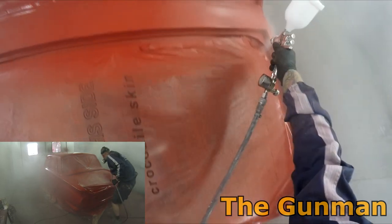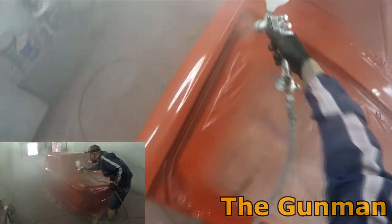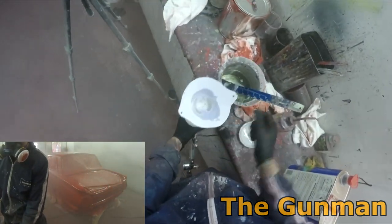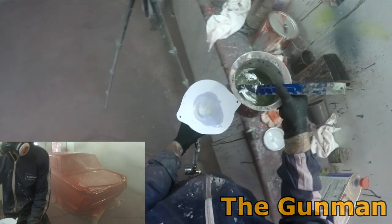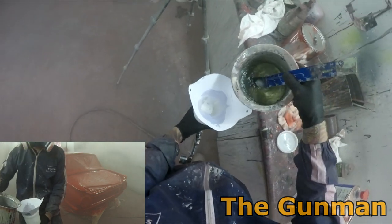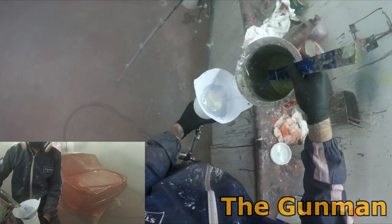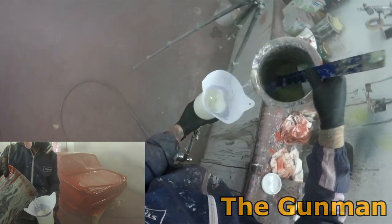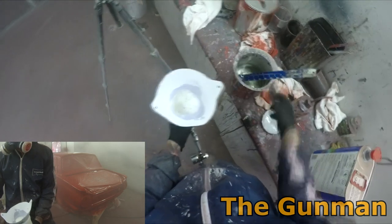But back to the high solids and medium solids, I do highly recommend using a high solid clear if possible. You will get more film build with it and use a lot less paint. Medium solids may be a little bit easier to use, but the way I see it, all you need to do is put a touch more reducer into your high solids clear. You've ended up making it go further that way, and you've basically turned it into a medium solids anyway.